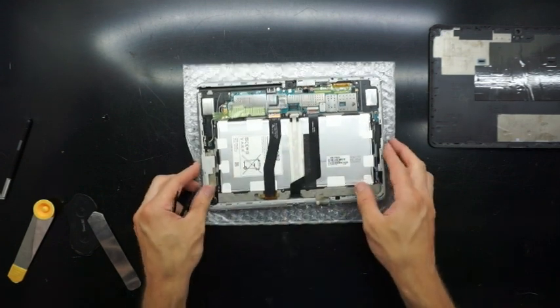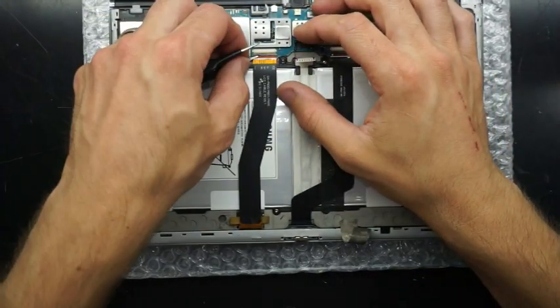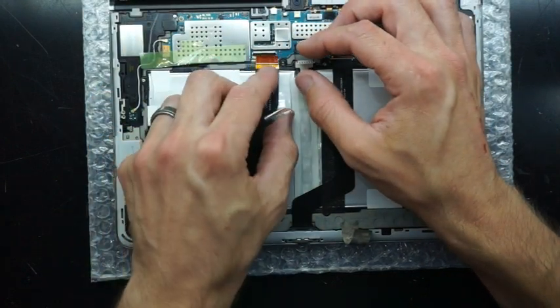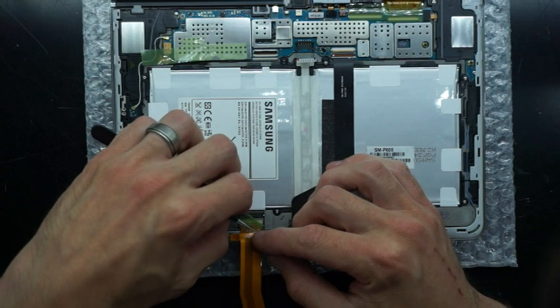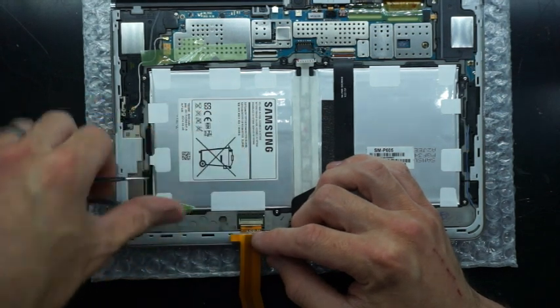I don't know why, but cable 10 usually fails and then stops having a backlight — or you'll still see an image on the screen but it will be very dark, very faint. Usually it's resolved, strangely, just by opening it up, disconnecting it and then simply reconnecting it afterwards. So that's exactly what I'm going to do in this video. Judging by the tape being in relatively stock locations, it's safe to say this one's never been opened before.